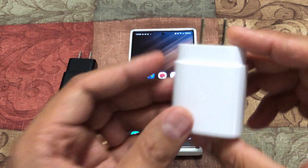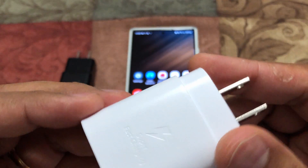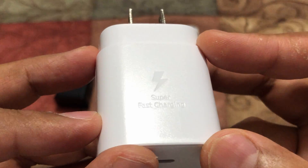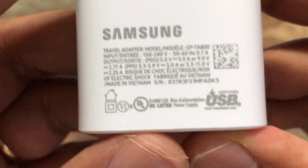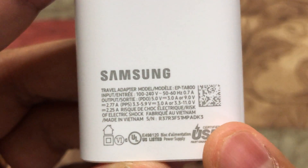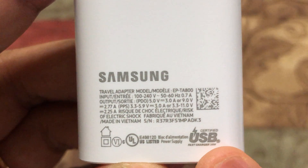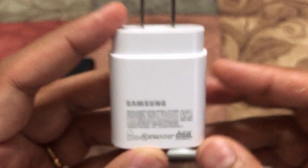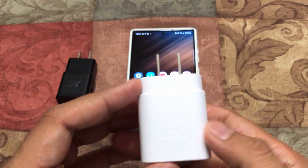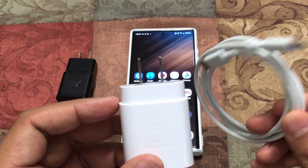For the 25 watt, I did buy this separately — it did not even come with a cable. This one says, as you can see here, super fast charging. If I turn it around, here is the max output. This adapter is also capable of PPS, which is programmable power supply, that can work with Samsung devices. Since it didn't come with a cable, I just used my old phone's cable, which is a white cable, during the comparison.